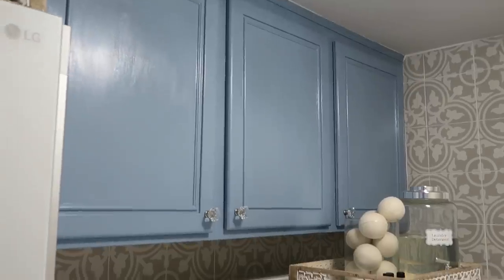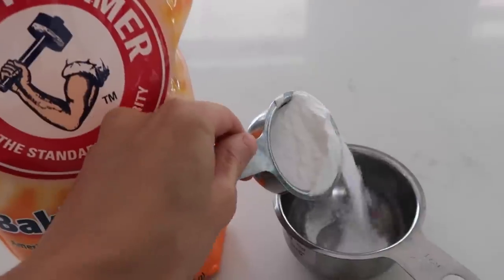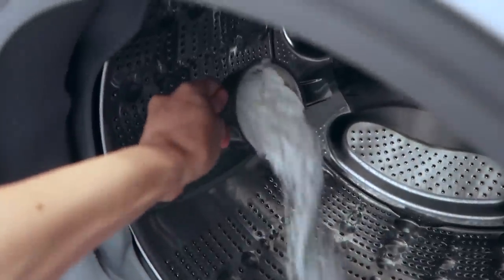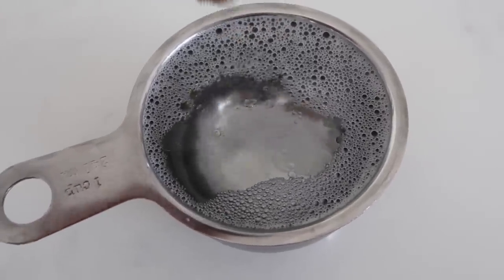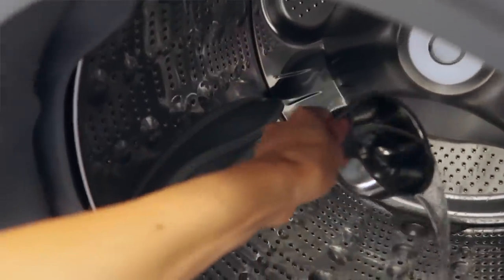The last laundry trick I want to share is to not forget to wash your washer — you can't get your clothes clean if your washer isn't clean, and it's very easy to neglect. I recommend washing your washing machine every one to two months. My washer actually has a self-cleaning cycle. Here's how you do it: take your empty washing machine, put two cups of baking soda, and run that on a long hot water cycle. The baking soda is a mild abrasive so it goes in, gently scrubs the interior, and removes moldy odors. After that cycle, add two cups of distilled white vinegar and about 20 drops of your favorite essential oil — I like lemon or lavender because those have antimicrobial properties. Then run that on another long hot cycle and the vinegar and essential oils will disinfect the interior of your washing machine.